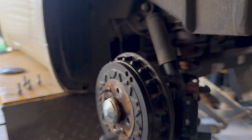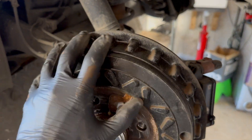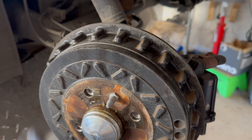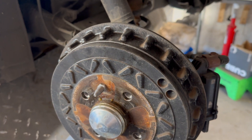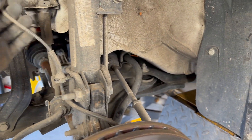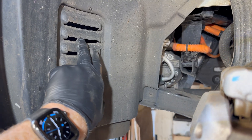Checking the drums — there's no drag going on there, they rotate really nicely with no resistance. I also check that the shock absorbers are not leaking, bump stops are correct, springs aren't broken, and everything is correctly attached. On the other side there's a little bit of drag — enough that I'm probably going to take the drums off and clean everything up in there. At 11,000 miles these things aren't really lubed from the factory. Also noting the pedestrian sound generator, which plays the warning tune.